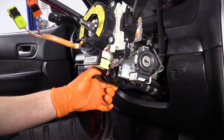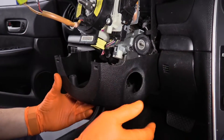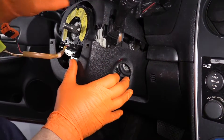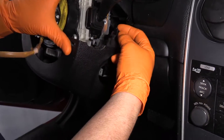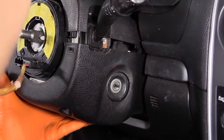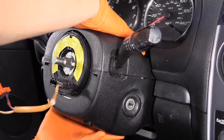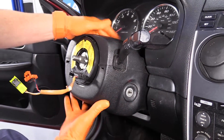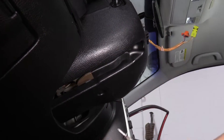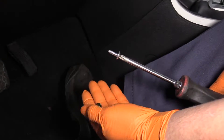I'm going to line them up. I'm going to pull down on the steering column tilt handle and line the plastic column up first, then pull it down and tighten it back up. Don't forget to replace the alignment of that bulb that illuminates the ignition switch. With that firmly lined up, take the top cover, snap it down, and remount the three screws. Remember: the two silver plastic screws go in the top front, and the one machine screw goes on the bottom.